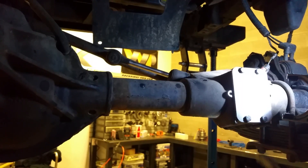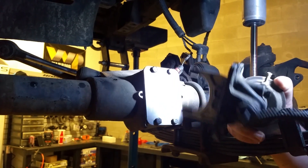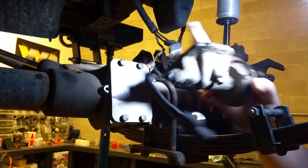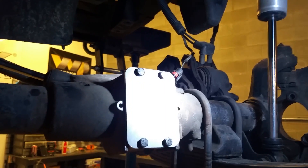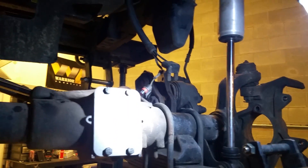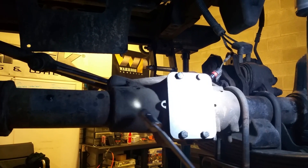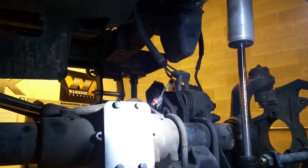So what we like to do is either get rid of this or replace it with a 4x4 Posi-Lock cable so that you can manually engage and disengage the shift fork, so you're not stranded. If the two axles aren't combined, the torque is going to go to the path of least resistance and stop right here because the axles aren't connected. This block-off plate simply covers up the hole when you remove the mechanism. You can identify if you have this setup by this large cast portion on the axle — it's not like this on a TJ or later YJ.